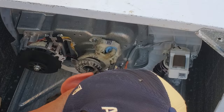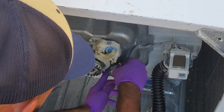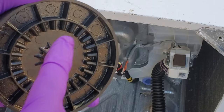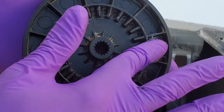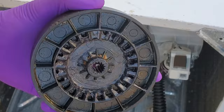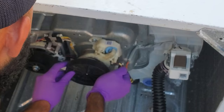After bolting it down, it should be a pretty smooth operation. Then we can just go ahead and plug it back into the connector. You can also clean up the transmission pulley and inspect it for damage — if it's not damaged, you can reuse it. Before reinstalling, we'll go ahead and grease up the teeth of the pulley as well. Once everything is greased up, the side of the pulley that has the teeth will go facing towards the inside of the washer, and it will just slide into the grooves of the teeth. Then we'll bolt it down.